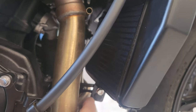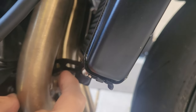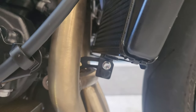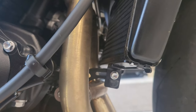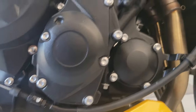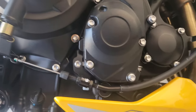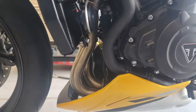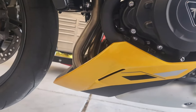There was one problem: a bracket here would hit the crossover tube because the hole was too low. I put a little plastic plug in, modified it, and re-drilled the hole. Thanks to a gentleman in my comments who said all you have to do is re-drill the hole - made it easy. Also, when doing the header, you remove this piece - it's got two bolts, one here and one in the back - and it drops right down. Super simple. If you can change the oil you can do this job. I was lucky - the header came with the O2 sensor already in it, and it also came with something that really surprised me: the factory header is really fat with the cat on it.